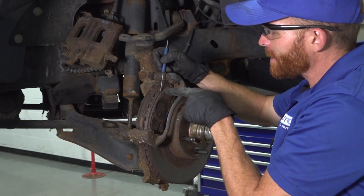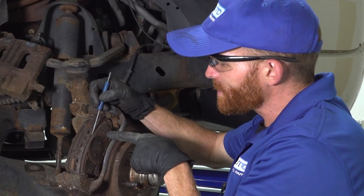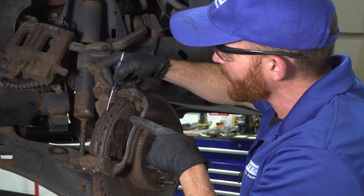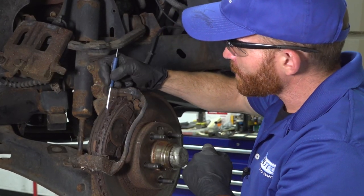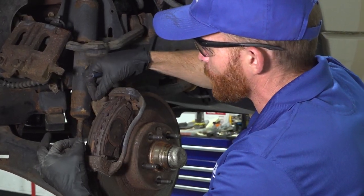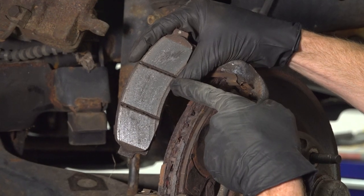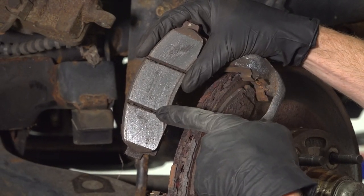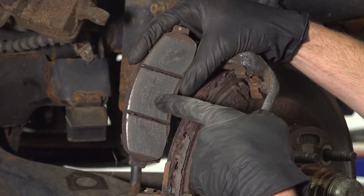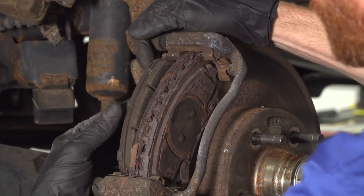With the caliper out of the way, let's have a close look at the brake pads while they're still in the caliper bracket. Looking at the outer pad, this one is directly up against the rotor — it's worn down to the point of probably being metal to metal. The other one still has plenty of material. Generally, a couple things could cause that: either one of the pads is stuck inside the bracket and cannot move, or there's a problem with one of your slider pins. Looking at the pad material, it doesn't look very damaged but it has a lot of heat marks on it.